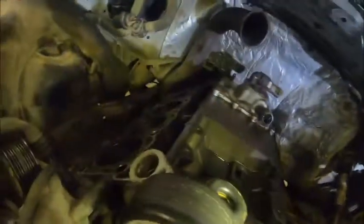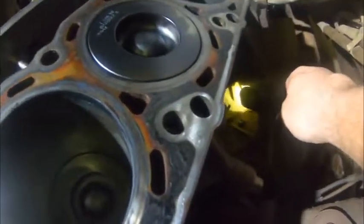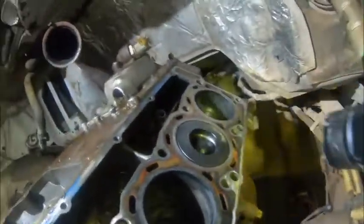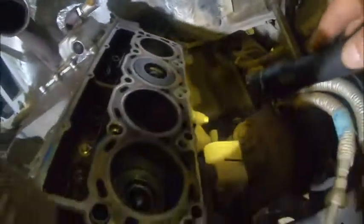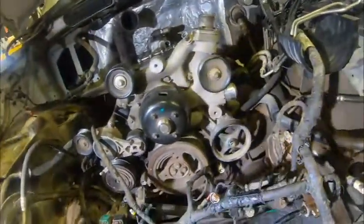It's a little tight on that side because of the angle. If you look right down in there you can see that rubber grommet piece — you can pop that out and get to your flywheel bolts right through there. The easiest spot is underneath the engine — there's also a rubber grommet underneath which is where I'm heading next to show you guys.